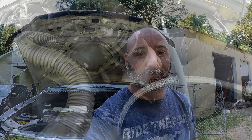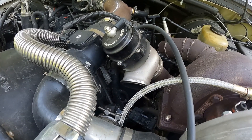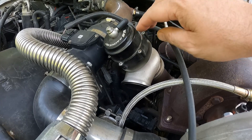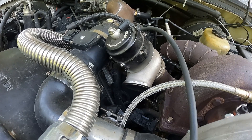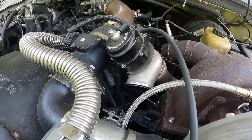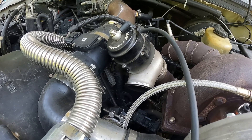That covers the previous problems from the last video, but we've had a few since then. As you can see, we're still ignoring the discharge tube on our wastegate. But other than that, we're having another problem with the wastegate and I'm not sure what it is yet. This thing used to discharge at 5 PSI like a switch. Here lately, it's been creeping up to 6 or 7 PSI when I really get into the boost while towing up a hill. So that's something we have to be mindful of and keep an eye on.